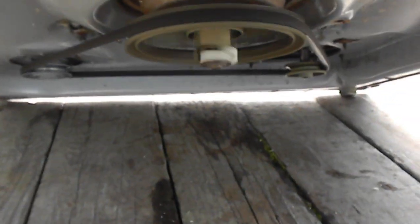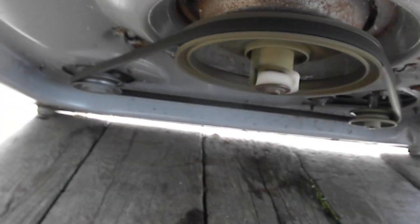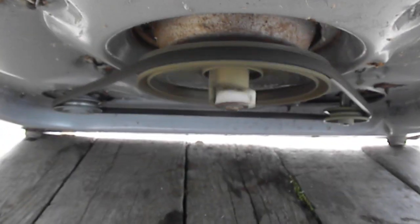If we look at the bottom, we can see the belts are intact and the pulley is spinning. So that indicates to me that the transmission is bad.